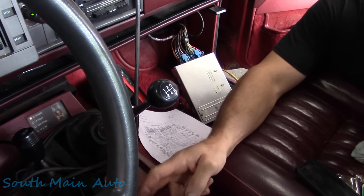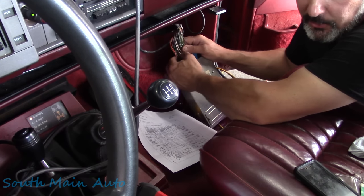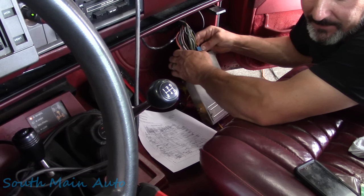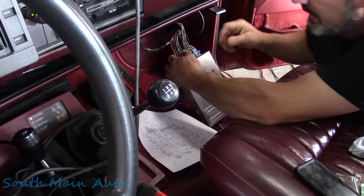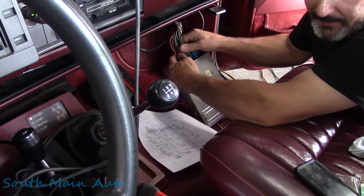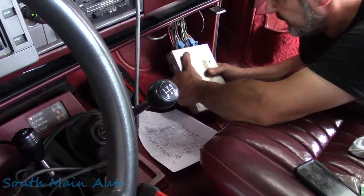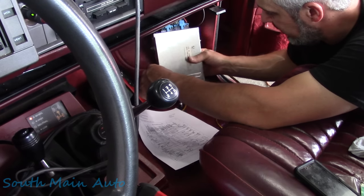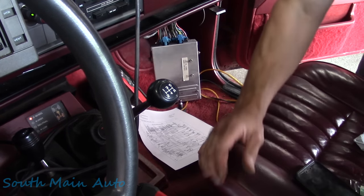Coolant's still at 122. I don't know if by tweaking on the circuit board here, it'll correct things or not. It doesn't really seem to be changing how the map is reading, or the battery voltage for that matter. Even if I play with the connectors, it still seems pretty repetitious. The only thing we can do is throw it back in the freezer, but at this point, I'm gonna make the call. It needs a PCM, see if he wants to fix it.